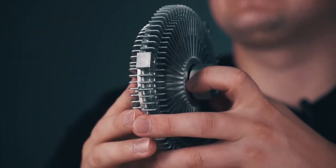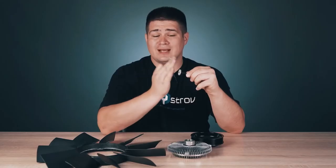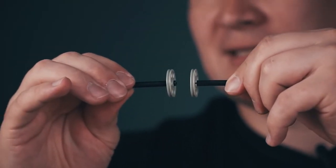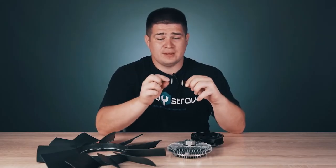Now let's talk about the device. There are two shear plates inside the viscous coupling system. One plate is connected to the input shaft, and the second plate is connected to the housing of the clutch itself. Using these two parts, I can demonstrate the design in a simplified way — here is a shaft with the first plate on it, and here is the second plate with its own shaft. This is how these plates are inside the clutch. There is no physical touching between these plates, just an empty space between them. If there is no connection between them, how then do these plates affect each other and how does the clutch work?